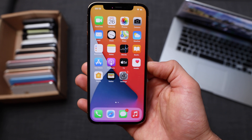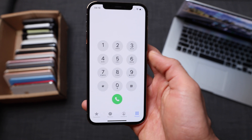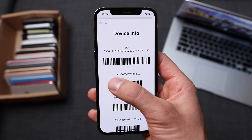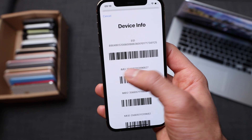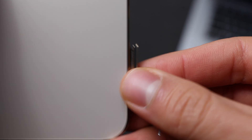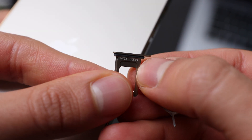The first thing you have to do is get your phone's IMEI number. Simply open the phone application and dial the following command: *#06#. Your 15-digit IMEI number will appear on the screen of your iPhone. We're going to use this number in a few seconds to do a remote carrier unlock. You can also find the IMEI number on the SIM card tray — it's a very tiny number written there.